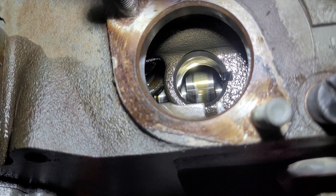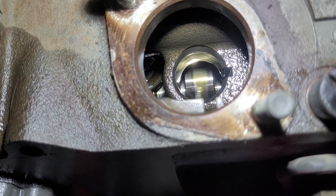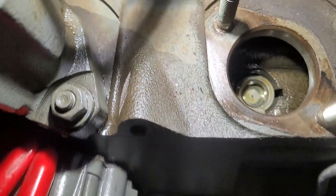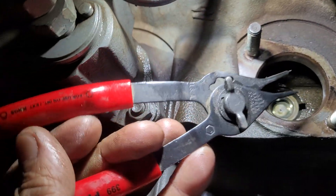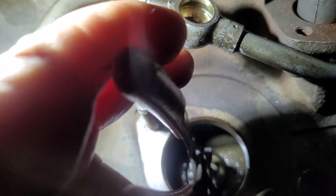The lobe should be all the way up. I already put the tappet back - I used only a snap ring plier for that. Make sure the top of the tappet has a dowel - always check that the tappet dowel is already seated in the slot. Put the gasket on here. I'm using the old gasket since I don't have a new one, but it looks good, so I'll put it back.